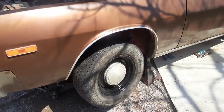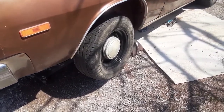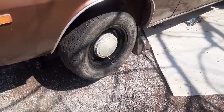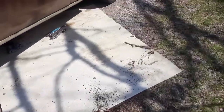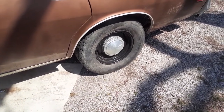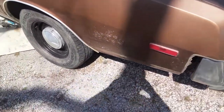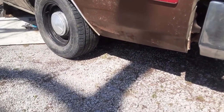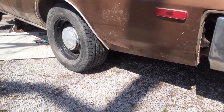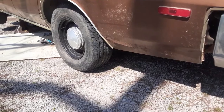The biggest deal is I decided on some wheels and tires. The fronts are 225-70-15 tires on 15x7 5th Avenue wheels, and just some dog dishes I had. The backs are a little bit fatter — those are 235-70-15s. At first I wasn't sure how I was going to like them, but honestly they fill the wheel well out pretty well. I've only got two mounted and of course this one went flat, so I'll find two more, but I think I'm going with 225s up front and 235s out back.